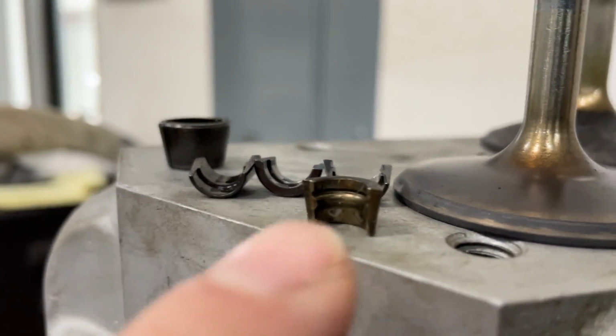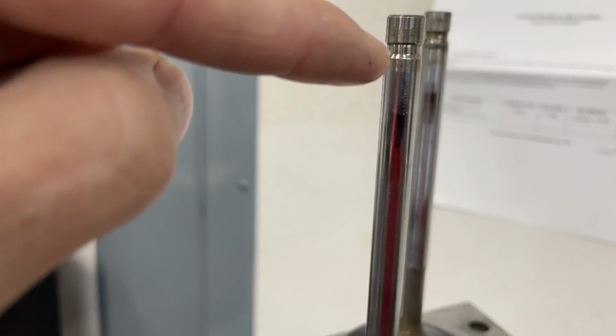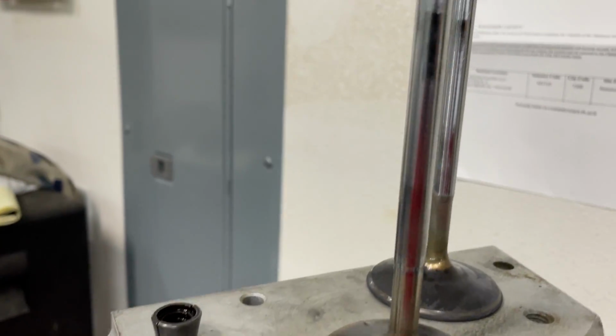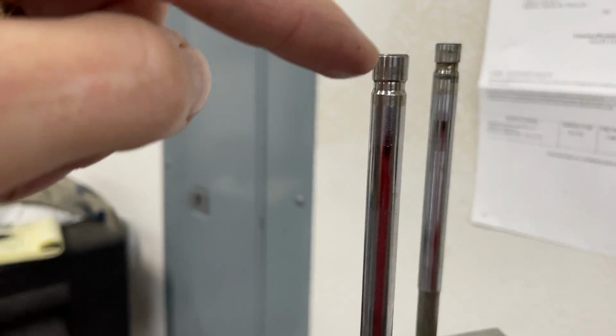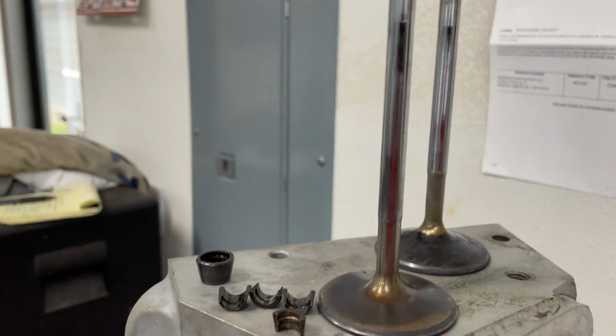Okay? They are different. The bead groove actually makes it stronger because at the top of the valve, the square groove, as the spring is trying to lift up, it's trying to roll that edge. It's much harder to roll with a curve, so the square will try breaking off the tip a lot easier than with a bead. Not that it happens that often, but the bead will roll and not try to take off the tip. I've seen several times where the tip of the valve's been broken off, and if it had been a bead, it probably wouldn't have happened.